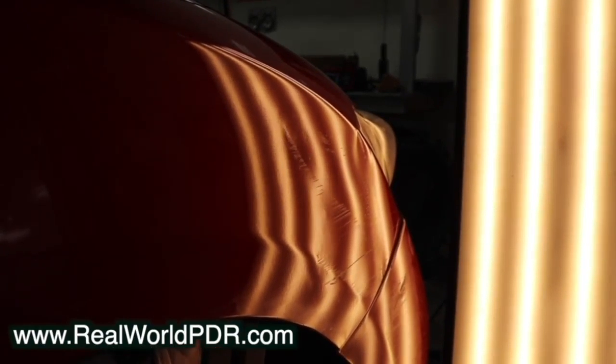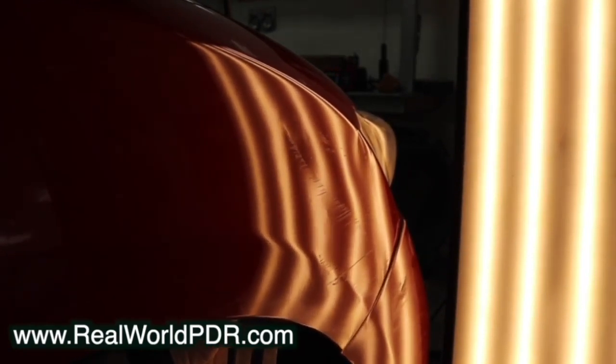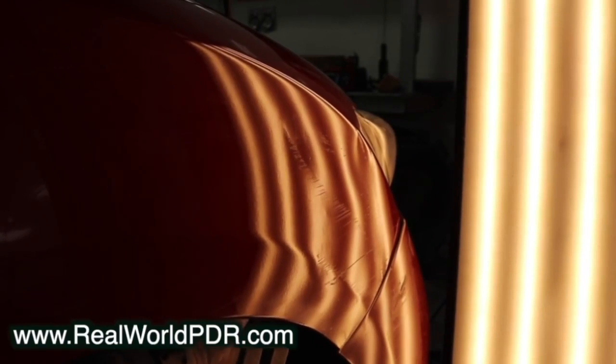If a crown is far too tight, you need to push to soften it up a bit. If you start trying to hammer on a crown that's too tight, you're going to be causing texture. The best way to speed up your repairs is to limit the amount of finishing work you have to do. So: to keep a dent clean, never screw up the cleanliness to begin with — or at the very least, think ten steps ahead and make sure you're taking care of future you.